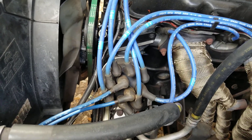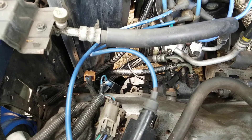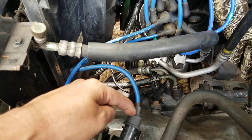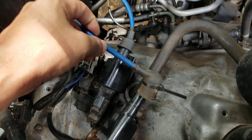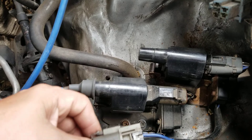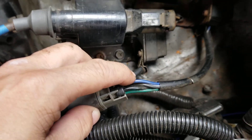As far as the intake and exhaust for your ignition coils, this can be tricky if you've never done it or you lose track of what's what. The bottom one is your exhaust side — I'm purposely leaving that connected — and the top one is your intake. There are two ways to know which is the proper spot. The exhaust harness has three wires; the intake side will have four. That's one way to know.